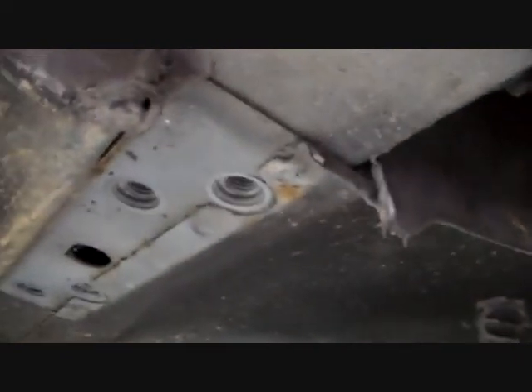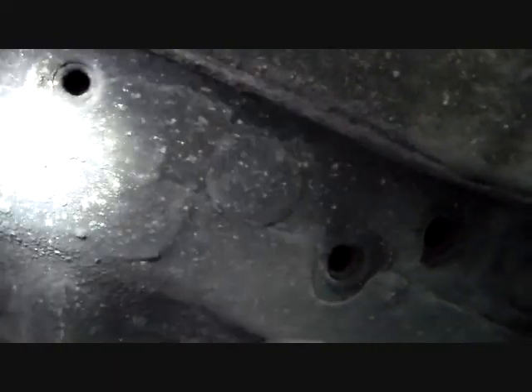The holes are already on the frame — really easy to get to. This is where we took the broken tow hitch off. There's two there, two there, and the four that are over here. I'm flying blind with my camera. There's the two fronts and the two rears. I'm going to take something and kind of clean those out first — take one of the bolts and run it up into each of those before you try to do it with the hitch on it.